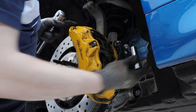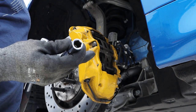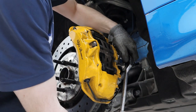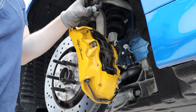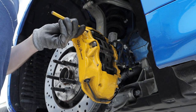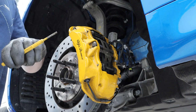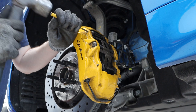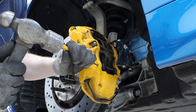First thing I've discovered: this bolt we've got to take out on the back side is a 13mm nut or bolt head, but you need to use a fairly thin socket - you can't use a thick impact-resistant one because it won't fit. It's not particularly tight, which is nice. So that is the little weird bolt that holds the big bolt in. Now we've got to hammer these pins out - you can use a screwdriver if you haven't got a proper punch, but a proper punch is better. This is always tricky not marking the calipers.